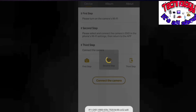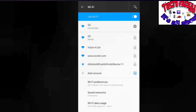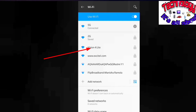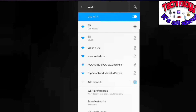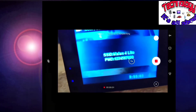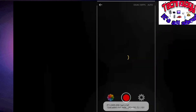The second step is to open the Wi-Fi connection on your phone. Make sure your phone is not connected to any other Wi-Fi connection at this time — if it is, you will have to disconnect and then reconnect. While reconnecting, you will find the camera's Wi-Fi name. I can see 'Vision for Light' here — I'll click on that. It is asking for the password, which will be shown on the screen of the camera. I'm showing it right now. Enter the password on your phone's Wi-Fi connection screen, and the Live DV app will automatically connect to your camera's Wi-Fi.